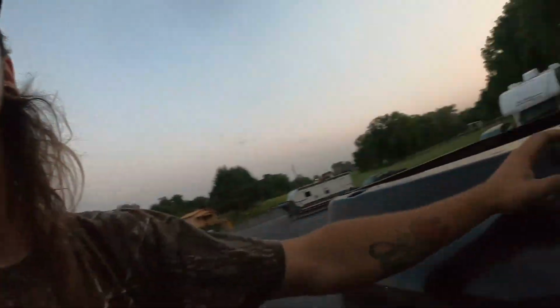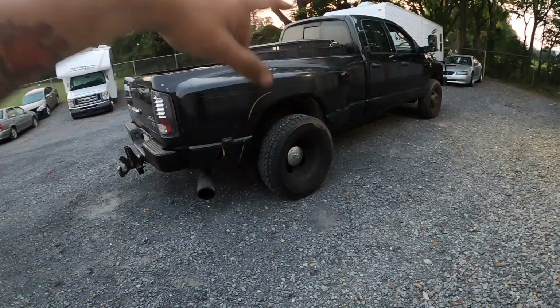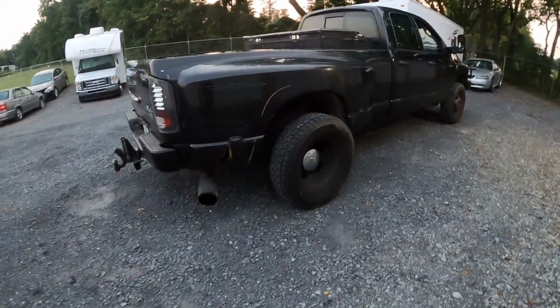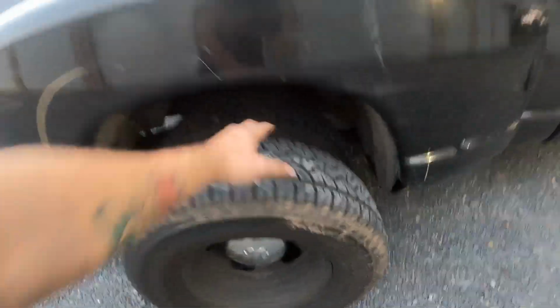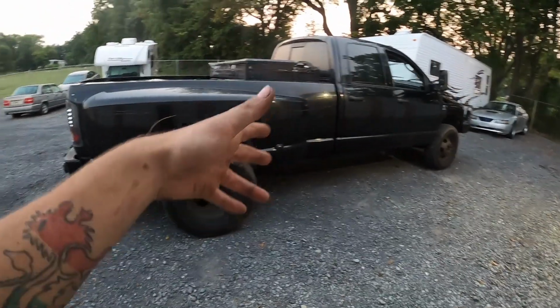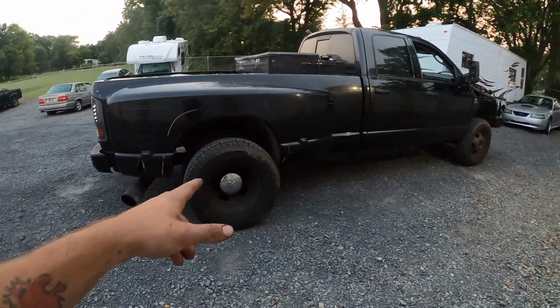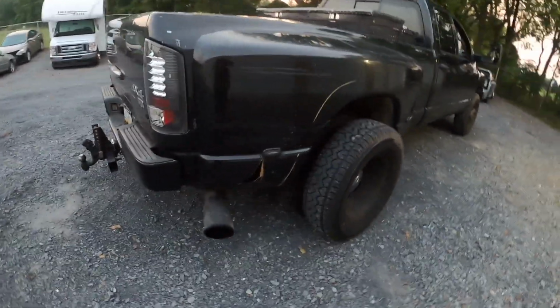I got them because I didn't have to drive a lot, and I did have to occasionally go off-road for certain jobs. Now, don't get me wrong, they came in handy when I was doing power only, but now that we're moving into the trailer world and car hauling, these I think are perfect. I could have gone with stock size, but realistically, to run this size on your truck, this is a 285/70R17. They look like stock tires to me, but they are way bigger if you compare them to a stock tire. You really only need a 1/4 inch spacer from what I'm told.